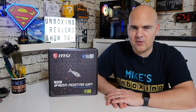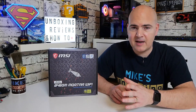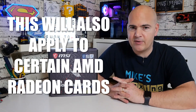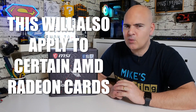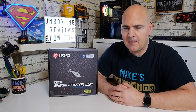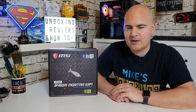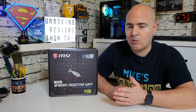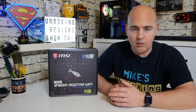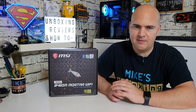In today's video we're going to do a BIOS flash on the MSI B460M Mortar Wi-Fi. This is particularly relevant at the moment - there is an update coming to NVIDIA cards which will allow the resizable bar feature, which will squeeze a little bit more performance out of your NVIDIA graphics cards, and potentially some AMD cards also. The latest BIOS available is a beta BIOS, so I figured we'd do a quick flash on the board to see what it's like.